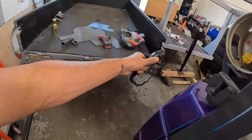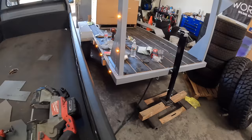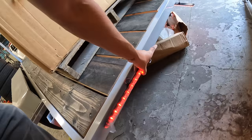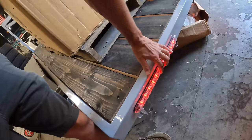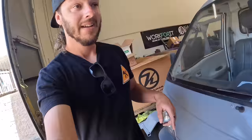Let's get her plugged in here. If the plug reaches when I'm 180 degrees and about a foot and a half away, this thing will still turn fine. Let's flip the lights on — oh, we got trailer lights! Running lights all down the side. The taillights I still need to attach — Sergio was running late so he didn't finish those. I'll self-tap them in since I pre-drilled all the holes and everything is powder coated on that inner edge. The turn signals work — emergency flashers on, everything is flashing perfectly, and these are also brake lights.